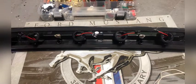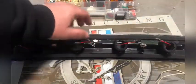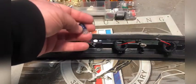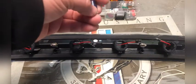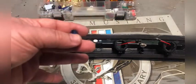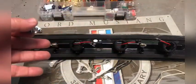So that's why sometimes people will put their rear taillights LEDs and everything will work fine, because these will still have regular traditional bulbs in them, which will show a resistance, because it actually sends a couple, it's like 2 volts. It's very, very light voltage it sends through your brake lights to see if it's telling the computer that your foot is on the brakes or not on the brakes, so it will properly lock up your torque converter if you have a car with automatic.